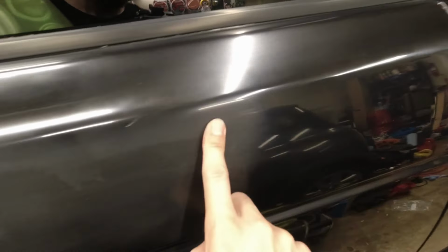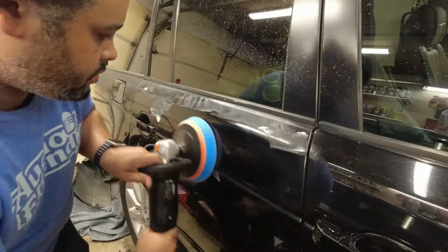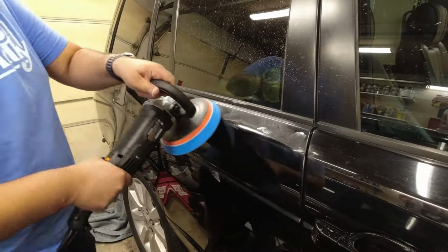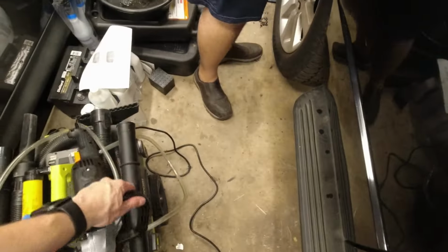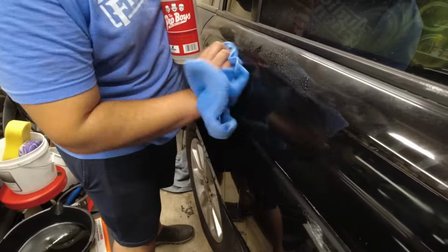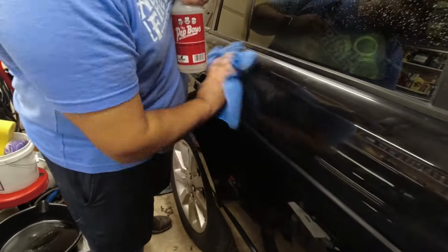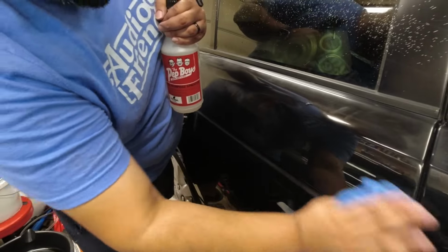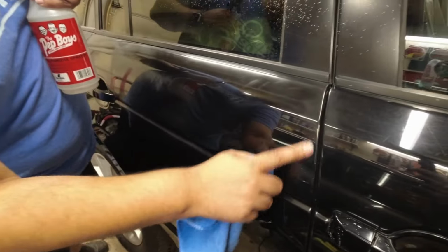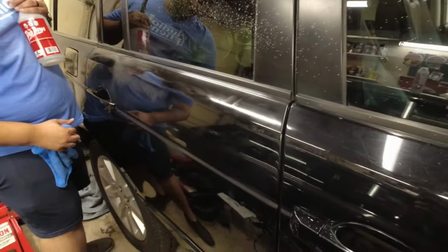Super smooth. For the machine polish, we're using a rotary buffer with Meguiar's Ultra Cut compound on a coarse foam pad to start. Because I think this is getting stuck on the oxidation. As the area you didn't touch at all. Yeah, you can actually still see the oxidation there. This area is nice, and I think with the orbital, it's actually going to come out really well. Might have to go over this by hand with the product.